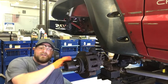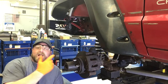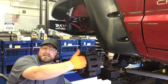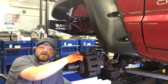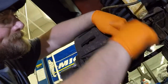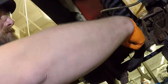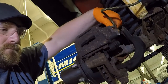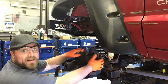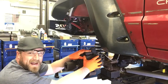I've got this base plate on here and I've got all the lug nuts snugged down in a star pattern. Now I have to remove this brake caliper. The on-car brake lathe is going to come in at the exact same spot that this caliper used to go on to. That way it's a clean shot into the base of the rotor so we don't have to worry about things like dust shields getting in the way.